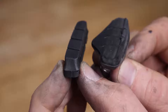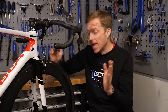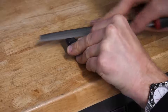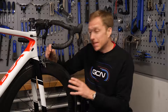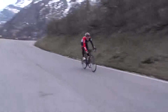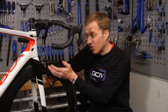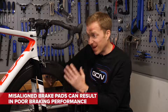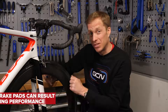Have a look at the actual brake pad itself and check how they're wearing. If they're flat and even then that's fine. If there's a groove then they may well need to be filed down and then realigned to match the braking surface. Misaligned brake pads mean you're not stopping to your full potential — you could be braking on the sidewall of the tyre or somewhere on the rim where the hardened braking surface isn't. Basically it's dangerous and you're just not going to get the performance that you need.